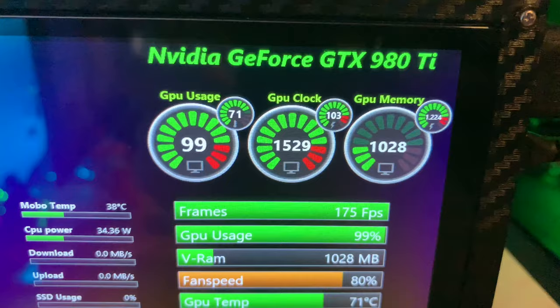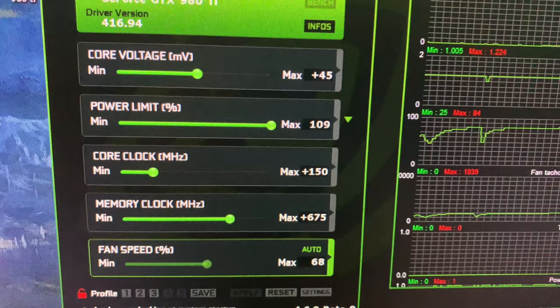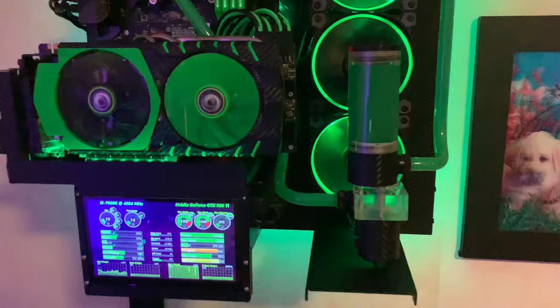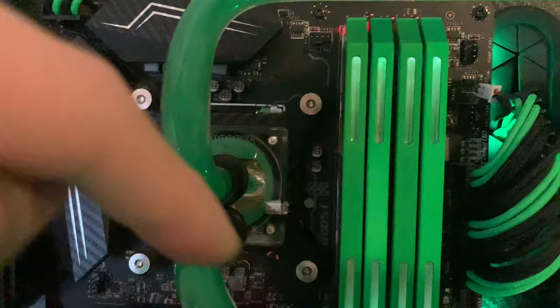It's pretty loud and has some coil whine, but actually less coil whine than the 970 I had. There's a hefty overclock — not as high as my old one, but the core clock is actually higher. Running Heaven Benchmark on these overclocks: 109, 150, and 675. 155 makes it crash, so I don't really need a higher memory clock. Sometimes when you plug in new stuff the BIOS resets — it actually shorted the LEDs I hooked up to a fan header set at 6 volts. When the BIOS reset it went to 12 volts and two LEDs died, so I have to replace those.